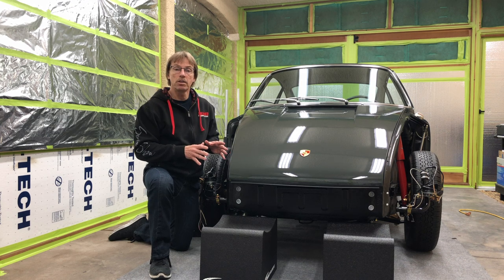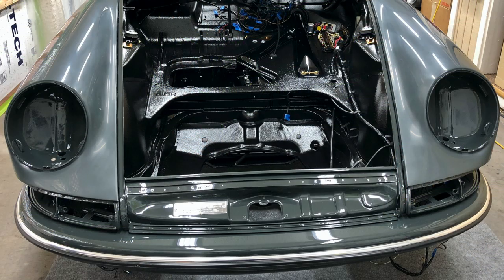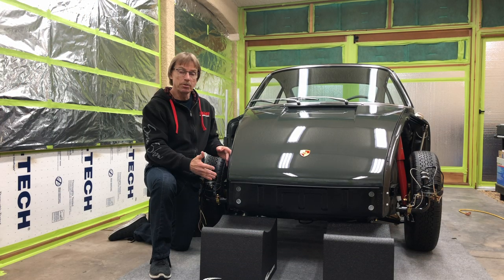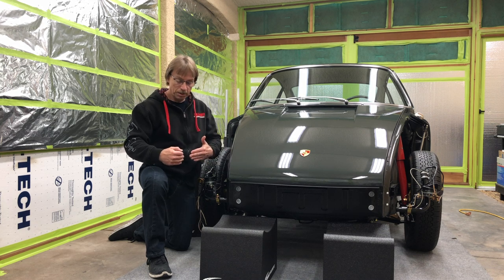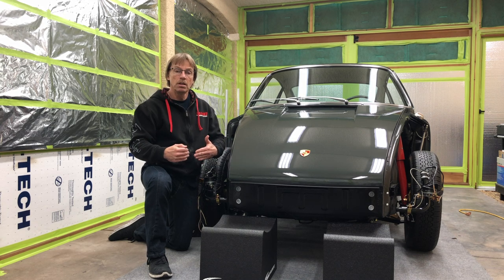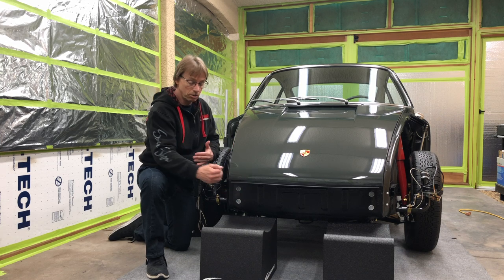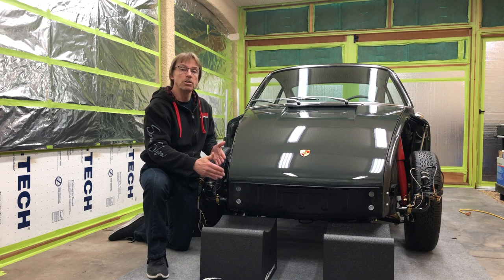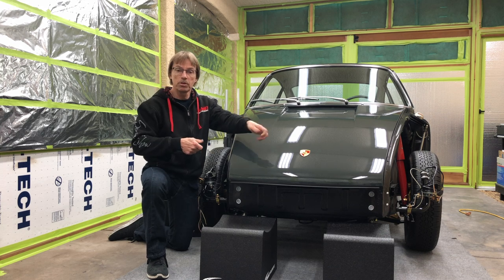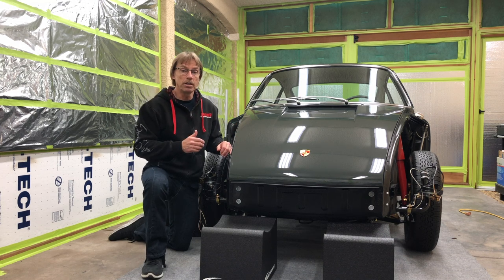I've actually done a mock-up on this about a year ago prior to the finished assembly. Let's take a look at a picture of that. You can see the fenders in place, the bumpers in place — there were no lead weights in the bumper at that time. We just wanted to mock up the fenders and align the left-to-right adjustment on the bumper while it was light enough and easy to work with. We could have the bolts underneath loose enough to make that adjustment, then made reference marks with tape on the inside, took measurements, and gently lifted the bumper off — taking measurements between the brackets so we could replicate that exact placement once we did the final assembly with the lead weights in place.